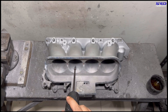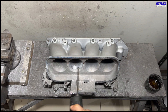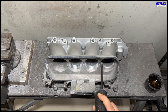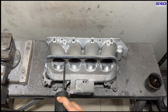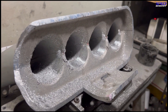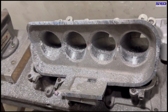Now here we are at the porting bench. We start with the carbide cutter to get the shaping done — it's not going to take too long, because if we go with the sanding roll it would take too long. Props to K-Power Industries, because this manifold's casting is really, really good, and the alloy mix they chose for the aluminum is actually pretty good. You can see it's cutting really well. Comparing it to an original Honda intake manifold, the aluminum quality is good. We can see the flaring is starting to improve. Now we invert it and go with the other side.